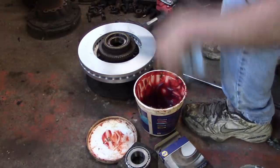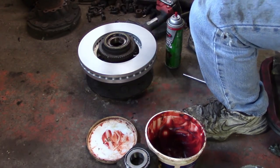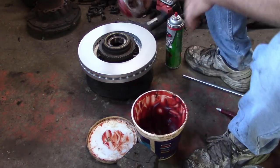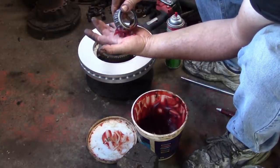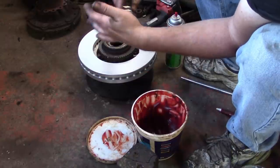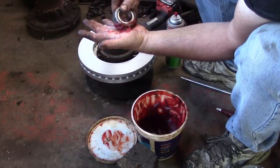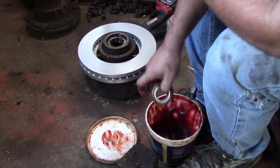Apparently I got a little bit of grease on there — we don't want that. I will clean this again before we put brake pads on. I'm going to pack the outer wheel bearing now. I just grab a little bit of grease, take it in my hand, and shove it up through there. I'll grab the grease and pull it back so I can see what's actually happening — I don't just want to cover it, I want to make sure it's coming up through the rollers and squeezing out. I know a bearing packer would be so much easier and faster. That one's ready to go — we are effectively ready to put the rotor on.